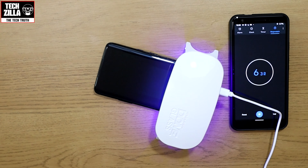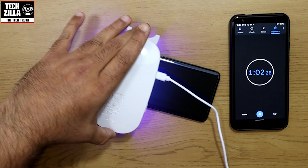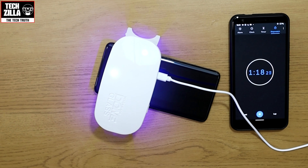The last stage is using the UV lamp again to cure the glue for a full 1 minute on the top half of the screen, and repeat for another minute on the bottom half.